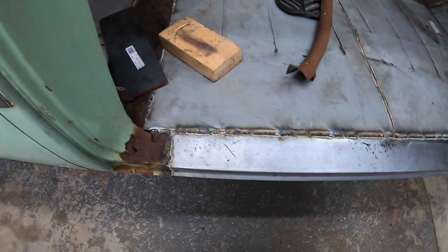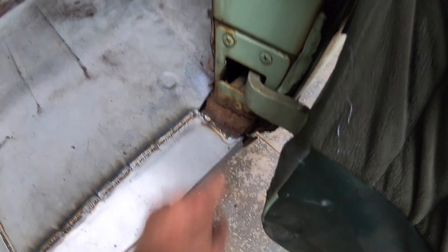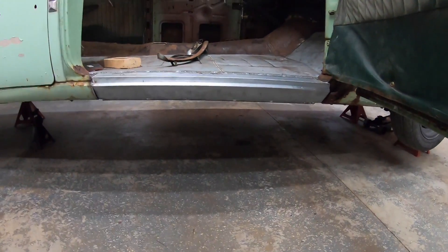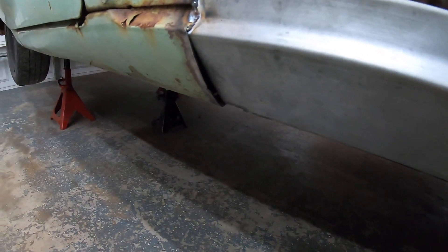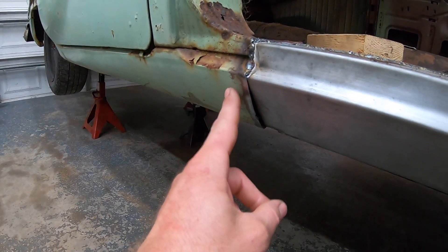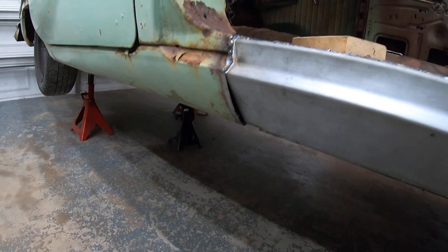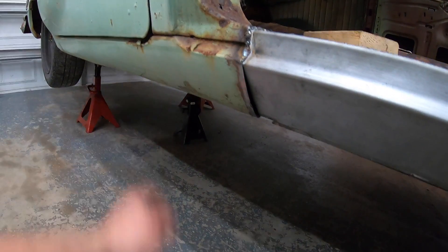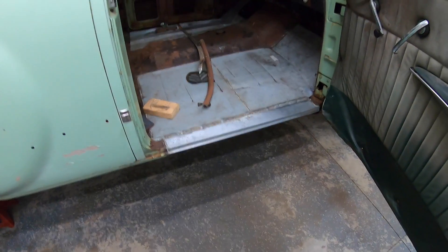You can see this rocker is now in the car, welded to the B pillar, welded to the floor pan, welded to the A pillar, but it doesn't fit perfect. Looking at it from here everything looks good - well, that's our problem. The angle or the bend radius of the old rocker compared to the new one is off by about a quarter of an inch in the middle, and that poses a problem because I didn't want to replace the rocker under the B pillar. Let me show you guys how this thing is assembled and give you an idea of how it all works.